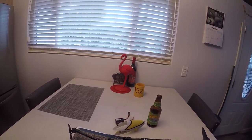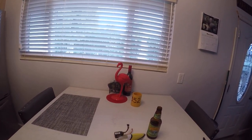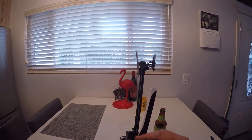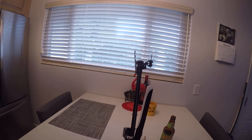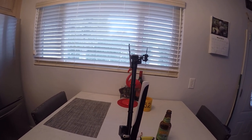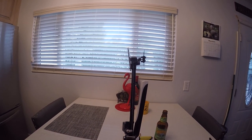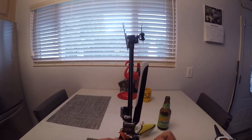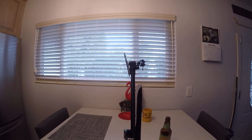What I did was actually lengthen the servo horn. You can see here that we used to have a servo horn with the rod on the second hole, and it's cut off at the factory, which I kind of wished was left alone so we could play with it. I happen to have another servo horn from a Spektrum servo. If you do have one, you can put an arm on here that's one hole longer, and with the longer hole you're going to get a faster response on this servo, enabling you to turn the gain down actually.